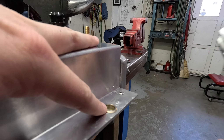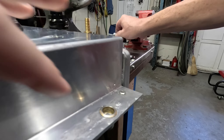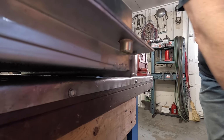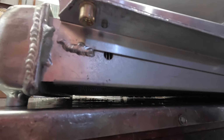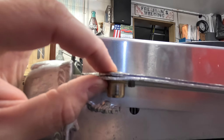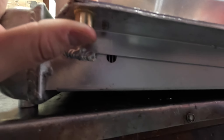As you tighten that bolt up, you can see the insert starts to collapse where the knurling is — the insert itself starts to collapse. That basically sandwiches the top of it. It has a flange around the top and then collapses on the bottom, and that threaded insert sandwiches these pieces together — it's in there rock solid. Just another thing that dad made to try and make everything a little easier.